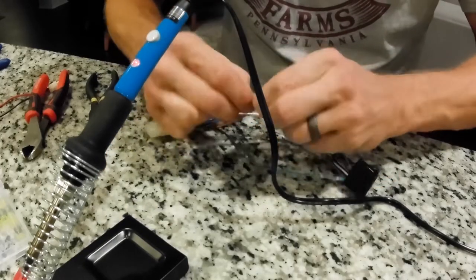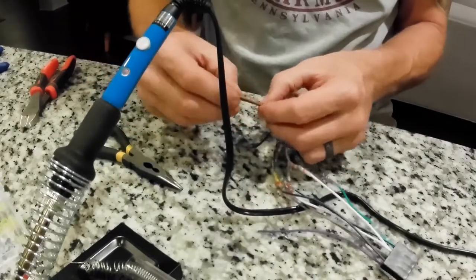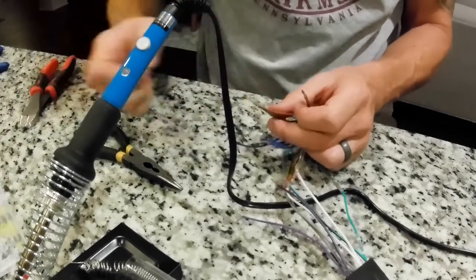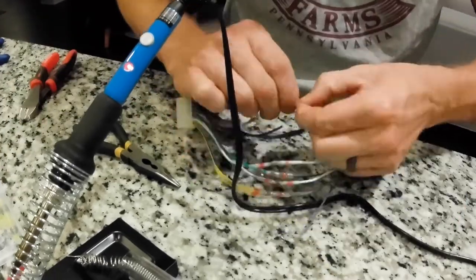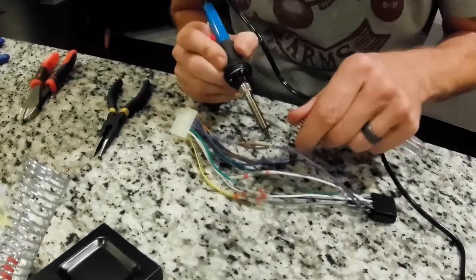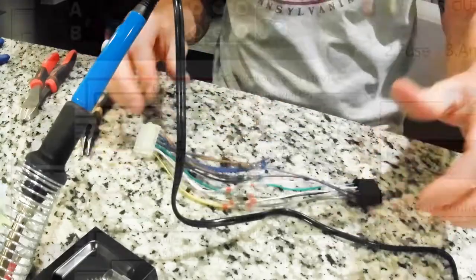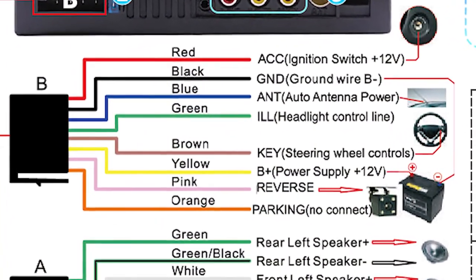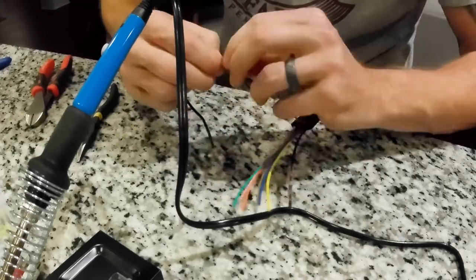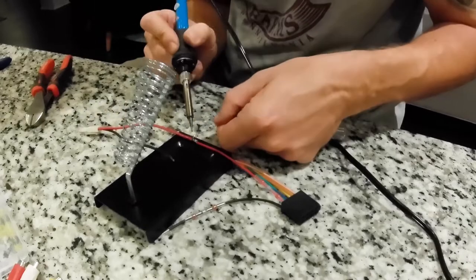In my RV it has five speakers. I'm going to have to double up on one of them because the new stereo only has four speaker outputs, since it's meant for a car. I'm going to pair the two front ones that are over the television and tap those into one channel. There's the finished wiring harness for the speakers. For the power connector, I'm going to need to put the yellow and the red together for our 12-volt positive, and the black cable will be our negative ground. Since this is a car stereo with a backup camera, there are going to be a lot of wires on this harness that just aren't going to be used, so we're just going to leave the ends capped off.